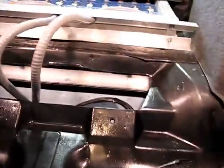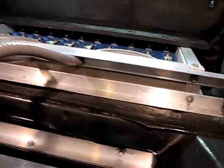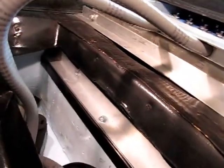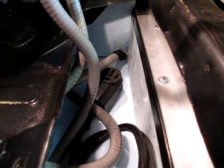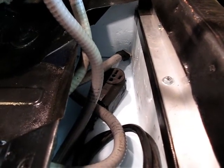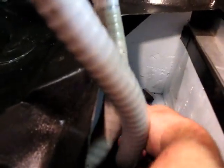So here we go with a super tricky to film kind of thing, because we're going to be looking into the battery box, just to give you an idea of what's going on back here. What we can see here is the NEMA 14-50 220 outlet that's wired to the gas filler cap, and that other cable there is just the Anderson connector that plugs into the charger and plugs into the DC side of things. Nothing's touching anything down here because of course it's all foam.